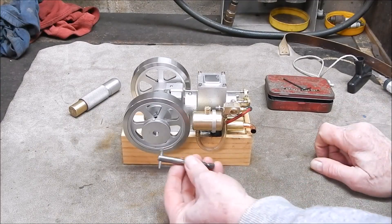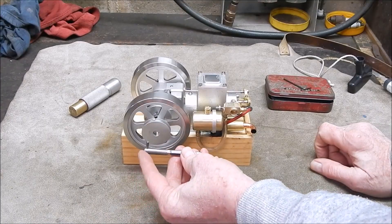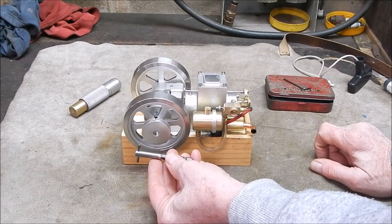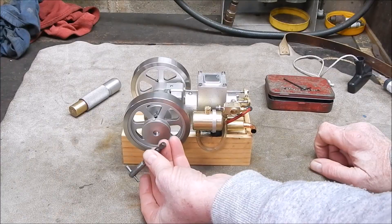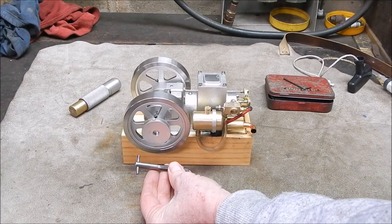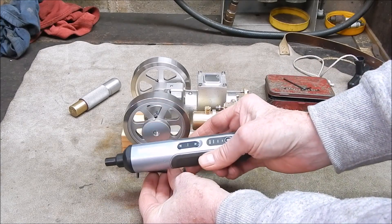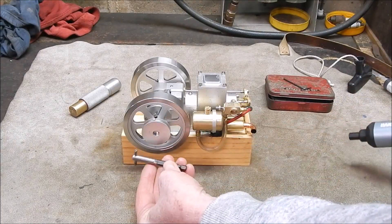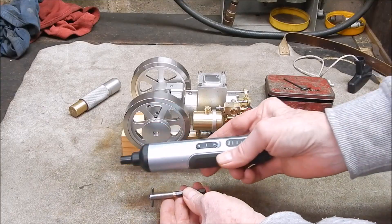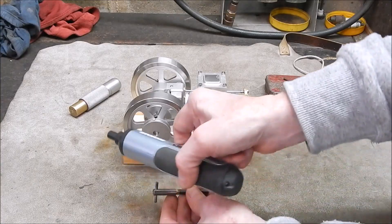So I might have a T-drive this morning - just knock one up. That's a roll pin, bit of steel rod bronzed onto a driver for my works electric screwdriver, which I hope will spin it over fast enough to start it. If it doesn't, I'll just have to put it in an electric drill, but I think this will probably be enough. It's quite handy to use.